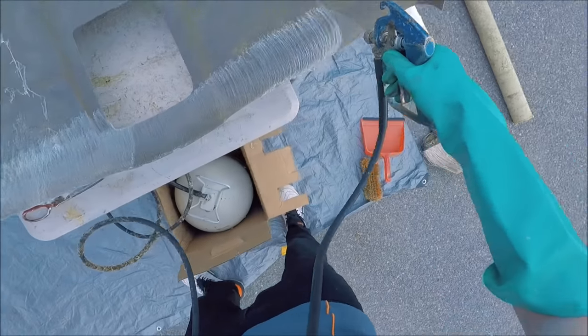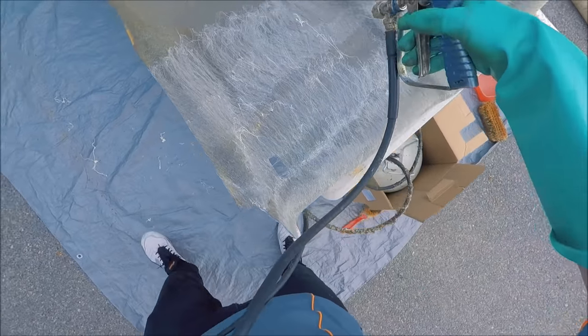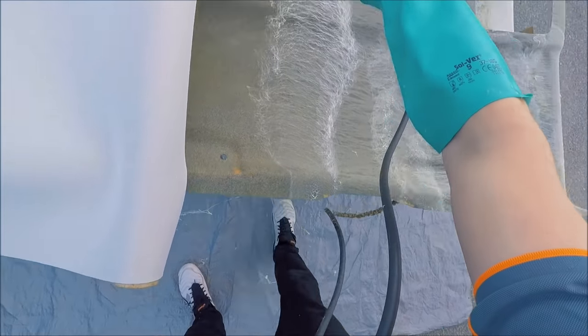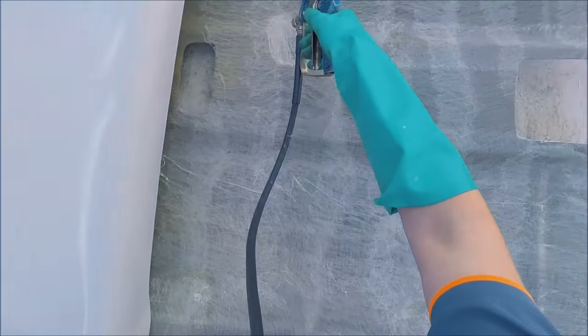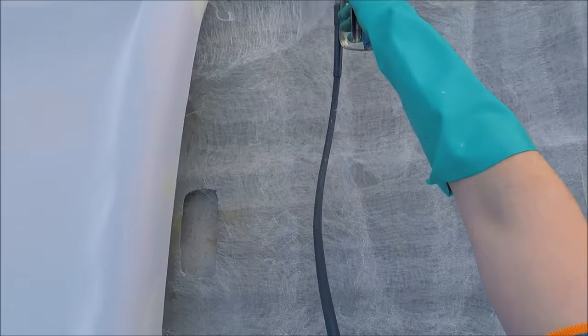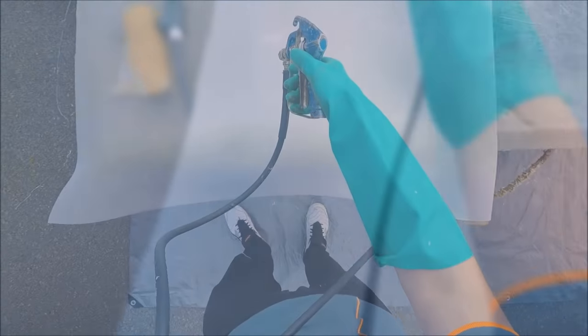Here we are adding the glue, spraying left to right and overlapping about 50% each time. A good glue to buy would be the 3M 76 Hi-Tac spray adhesive, or another brand would be Permatex carpet and headlining glue — we'll put some links in the description below. We cover one half of the headlining board first, going up and down then left to right. After that we spray glue again in the highest stress areas, such as around any curves or bends where the material has to follow the shape of the board. Then we spray the back of the material — because it's foam-backed, the glue won't seep through and show a visible stain.